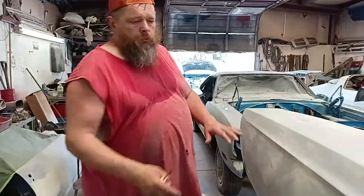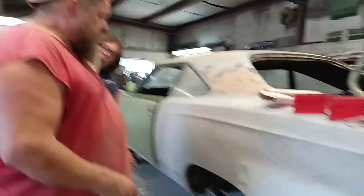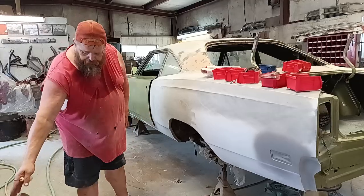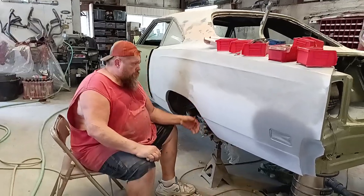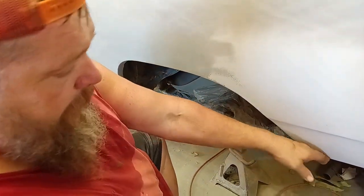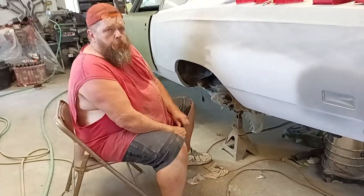When you buy quarter panels — this car was creamed down the side so we had to put a quarter panel on it, and another quarter panel over here was rotted away. When we bought the full quarter panel, it was wavy as water on a lake, so it took a lot of body work to get it flat. When we cut it off, the inner fender was also rotted, so we bought it — but the inner fender did not have the same wheel opening hole as the quarter panel. If you made it touch here, there was a gap back there you could put three fingers in. When you buy two aftermarket panels, no two panels fit.